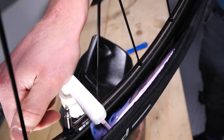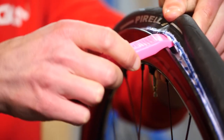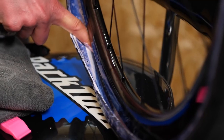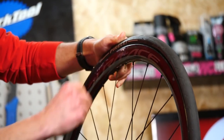You've got a few different options. Option one: add more sealant in the hopes that it plugs the hole up and you'll be good to go again. Option two: remove the tire, clean it up and put a patch on the inside of the tire — keep your tire in good use, get lots of life out of it. Third option: take the tire off, remove all the tubeless sealant, patch the tire up and run it with an inner tube, and it should be good to go for plenty of extra miles. Or the fourth option is to use a tubeless plug. Check them out — good option.